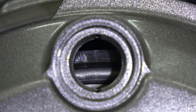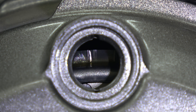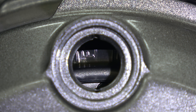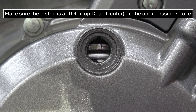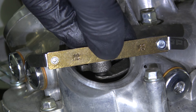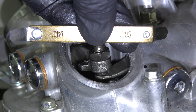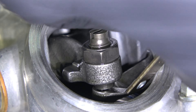Slowly turn the crankshaft counterclockwise using a 17mm socket. As you turn over the motor, look through the timing hole — be aware that the crank will sometimes rotate a bit on its own. The timing hole shows a mark with a T; the line next to the T indicates top dead center, or TDC. The same T mark will be visible at TDC of the exhaust stroke and TDC of the compression stroke. When at TDC of the exhaust stroke, there will be no slack in the rocker arms. Continue rotating counterclockwise — avoid turning the crankshaft clockwise to match up markings. Turn the crankshaft one full rotation to ensure the piston is at TDC on the compression stroke.